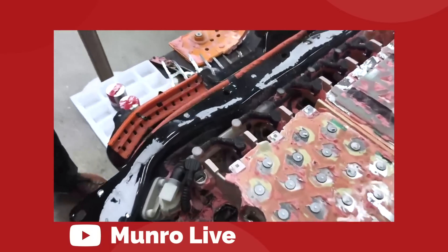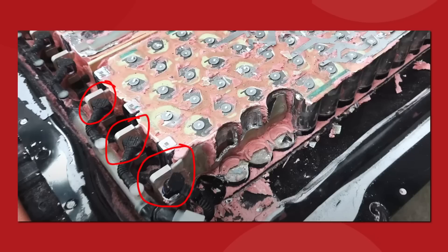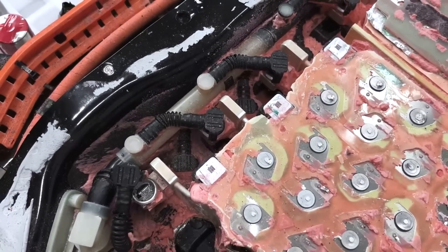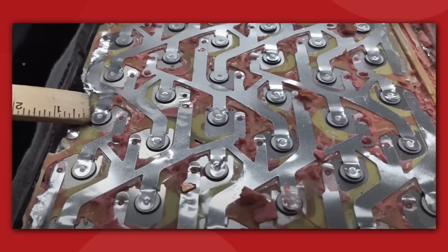The active cooling is in fact coming through side-channel cooling, which is the standard for cylindrical cells, but we've never seen it used on cells as large as the 4680. There seem to be three main cooling channels per module — between the first and second row of cells, between row 3 and 4, and between row 5 and 6. So each cell is in contact with a cooling channel on one side, but the area of the cell casing touching the cooling channel is pretty small compared to its entire surface area, which may limit cooling effectiveness.